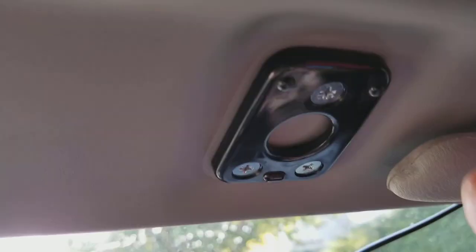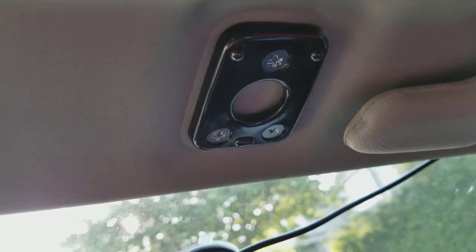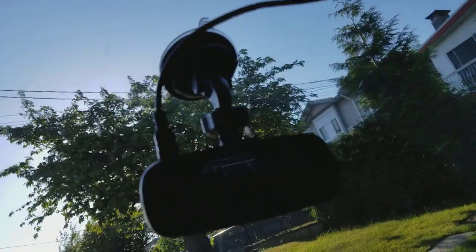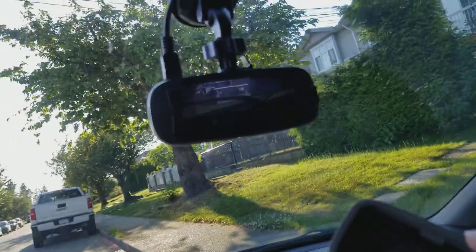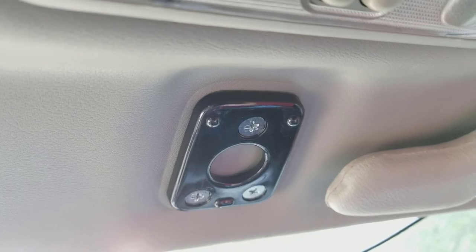I've taken off the bracket here. Without this black thing, you're left with three holes in the headliner and it looks kind of ugly, so I just put this back and they'll just chill like that. The bracket needed to come out otherwise it'd be rattling all over the place. So now the bracket's in the mirror assembly here. The bracket's back on in here - you can take the screw off and then put it back on. That was fairly easy, fairly straightforward, nothing permanent as if it was attached to the windshield or something. Integra mirrors are actually really easy to work. The next step is to take these screws out and then same thing on the other side - those four screws, the flat head works on these, and then we'll be able to take the visors off.